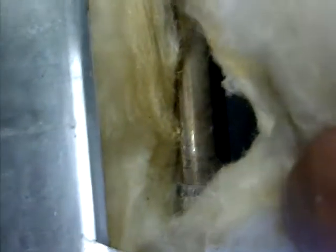Heating elements can rupture, expand so much, or rust so bad that you can't even wiggle them. But since that's not the case here, now all I'm going to do is start pulling this up. Before I take it out, come around this side and see where it's inserted. They usually put two holes because if one ruptures and you can't get it out, you can always use the other hole. I've left almost everything attached so I don't have to put it all back together — that's how I save a lot of time. Bring my heating element back around; save myself tearing the whole thing apart.